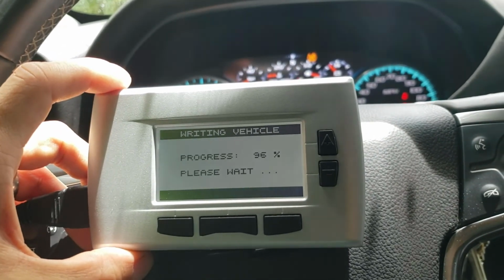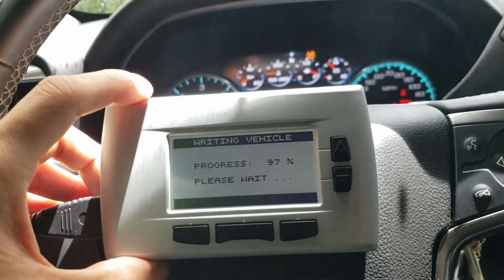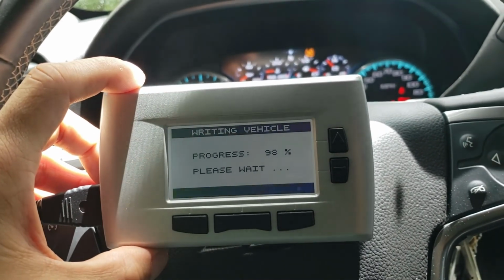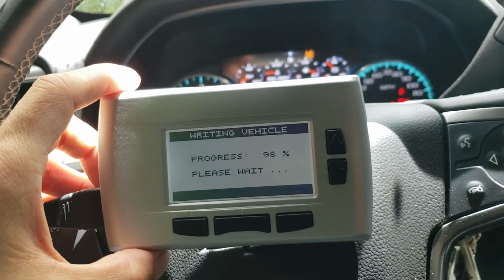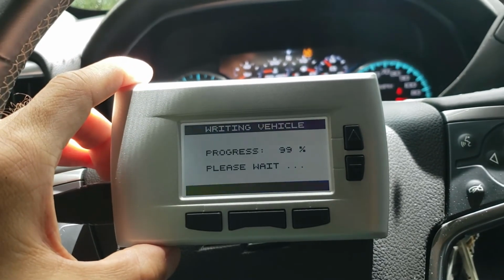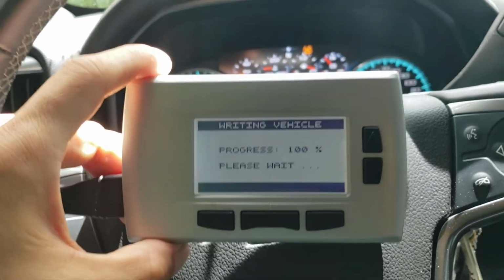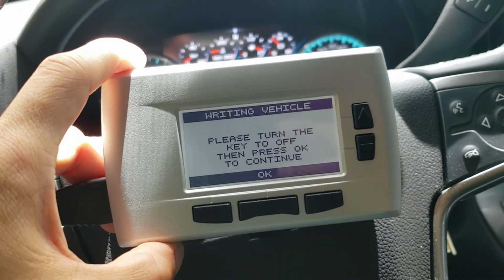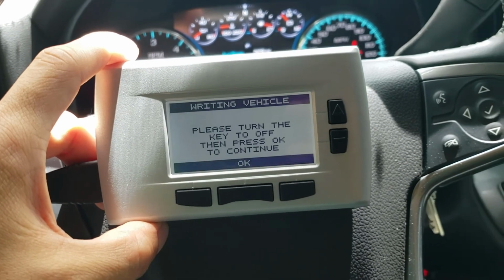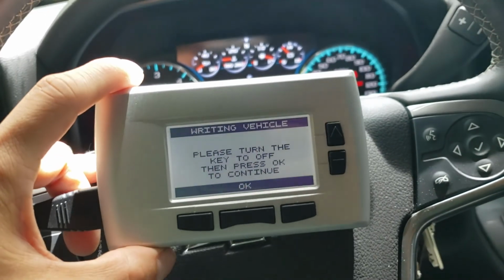But if you paid $350, this is basically a glorified AFM disabler. So if you're looking for disabling underneath a certain speed only, then this is good. Other than those ones that disable it full time, because you are gonna lose some mileage if you take the AFM off full time. Some people may claim that you can increase your MPGs by taking off the AFM, but it really is going to depend on your driving. And for me, that's not the case. I lost maybe 1 or 2 MPGs by having the AFM totally off.